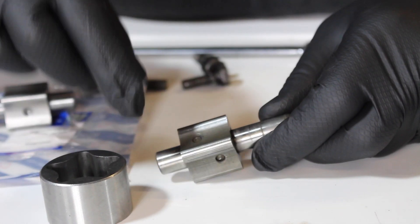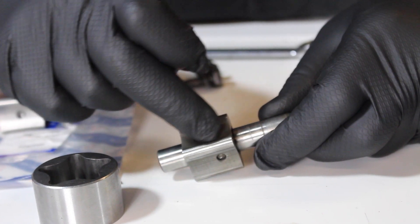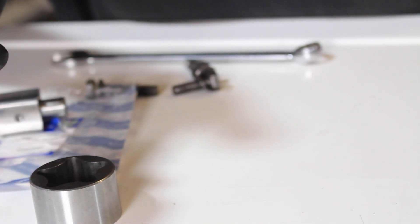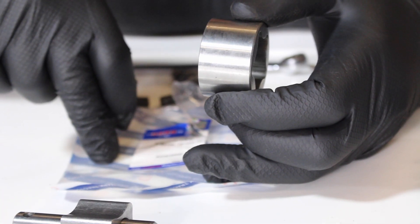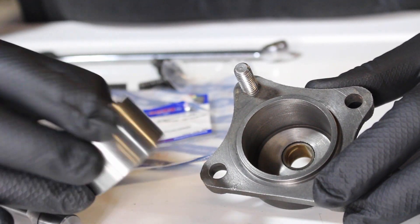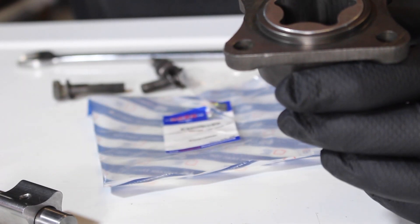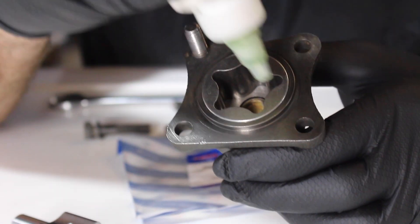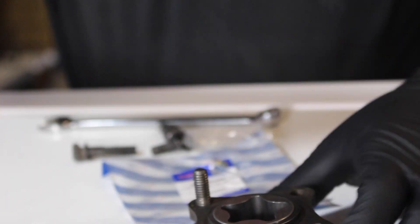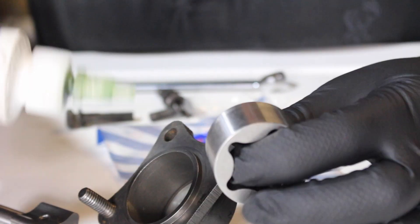There's the other part of it where we can see it's worn on these edges here as well. Because we're rebuilding the entire engine, we're going to fit a new rotor and shaft — I supply these if anybody wants one. So we grab this piece and that will lay inside. Get a little bit of oil as well, which we're going to put in there. This is my assembly oil but you can use normal engine oil — it will work just as well.